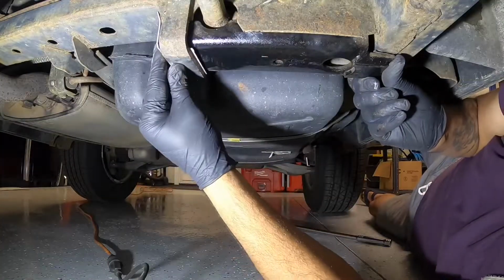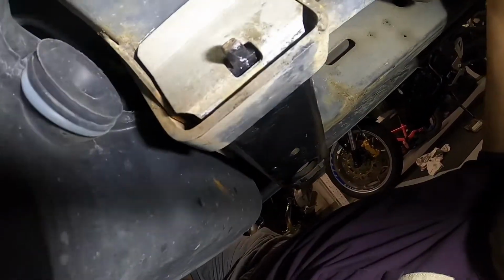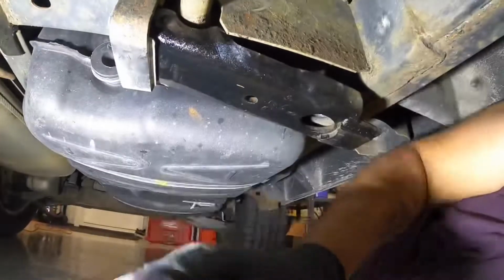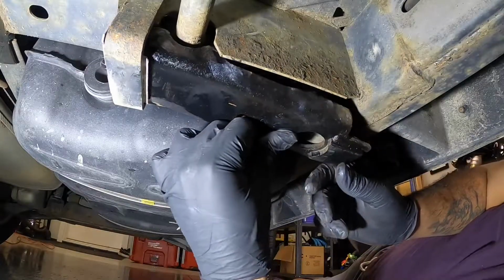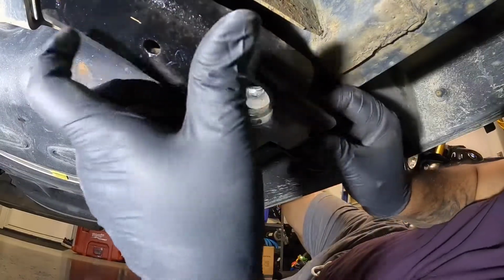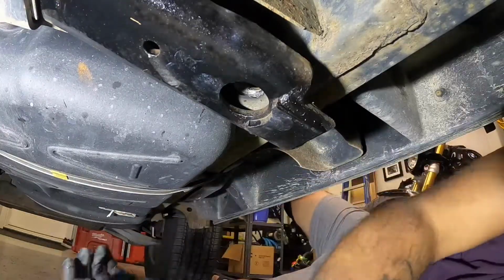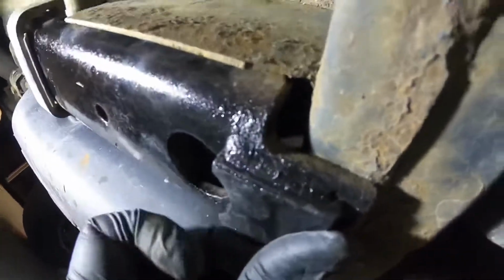And now the only thing we gotta make sure is that this notch here, this is exactly how the notch is supposed to sit, guys. You gotta have this little pointy thing come out of the backing plate. And then we need this solid steel to go on, and the other notch here, there's a small notch. I'll show you on the other plate. This notch on this end needs to go in this hole here. Right there, there's a hole. So the notch goes on it, and then it sits flush.